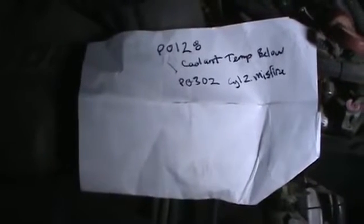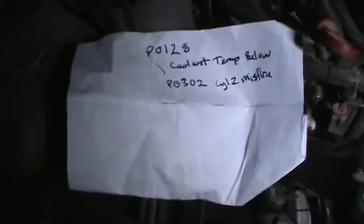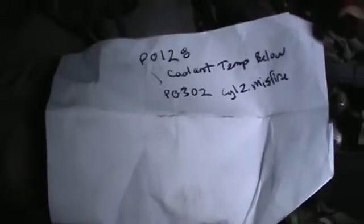I had him warm it up and filled some more coolant in it. Most people would just change the sensor, but you're not supposed to do that at the first sight of a coolant temperature below threshold code — don't just change the coolant temperature sensor right away.